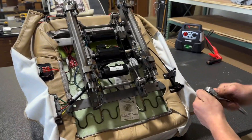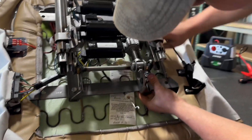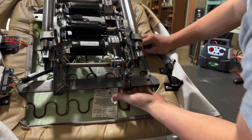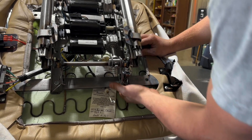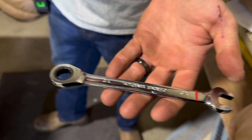Normally I would do this right when I transfer it over, but you want to make sure you end up tightening these bolts down. If you hold your fingers on the bottom — as long as there's a locking nut — if it's not a locking nut, just get an open-ended half-inch wrench, put that on the bottom, and you'll be able to hold it in there.